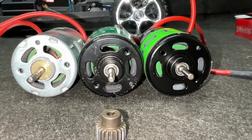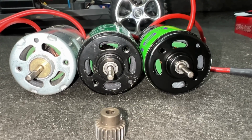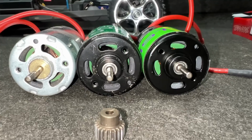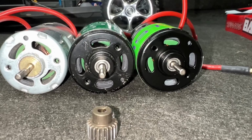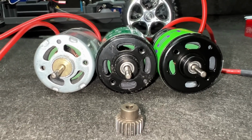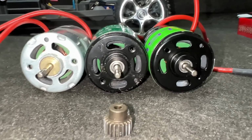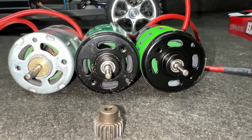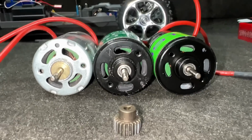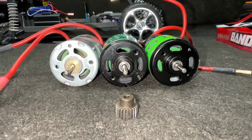One of the biggest differences between these motors, aside from magnets and, you know, obviously build quality and all that, is that front bearing on the 2 Holmes motors. That's huge. Under load, under that pinion gear being under load, taken off and all that, that bushing adds a little bit more resistance. So these right here should be more efficient and hopefully faster. But that guy right here, that big 12 turn, that's what's about to go in.